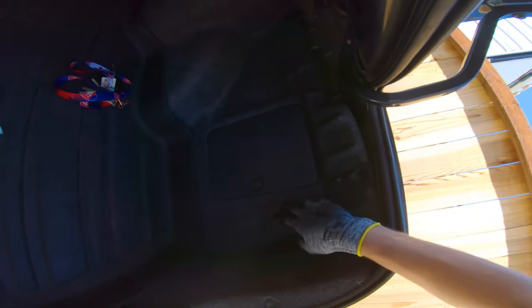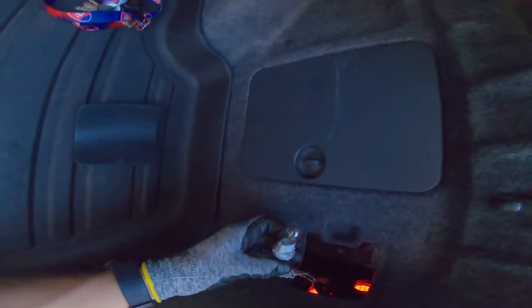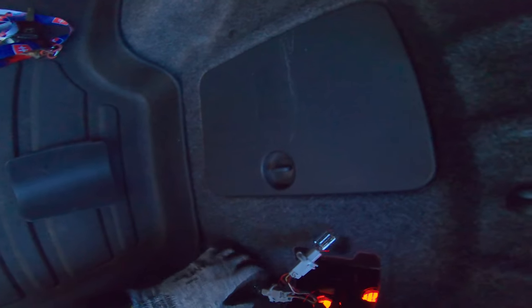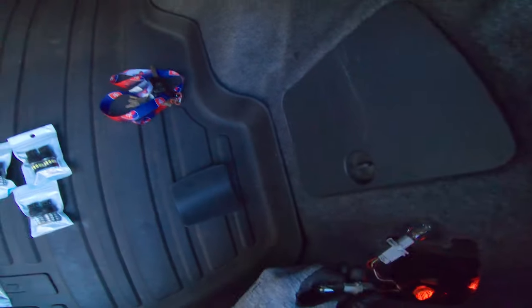There are two panels on each side — you're going to want to pull these out. Just pop them out. Now we can twist our bulbs — twist it towards yourself and slide it out carefully. The bottom is the turn signal, the top is the brake. Twist it towards you, it'll make a little pop, pull it out nice and easy. Do the same for the other side. Now we have our stock bulbs. The top, which is the brake, is 7443. The bottom, which is the turn signal, is 7440. Remember that — you'll need it.